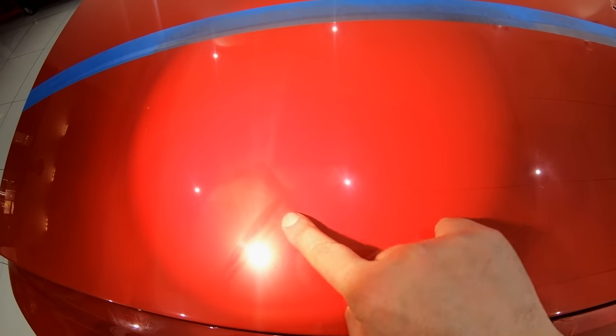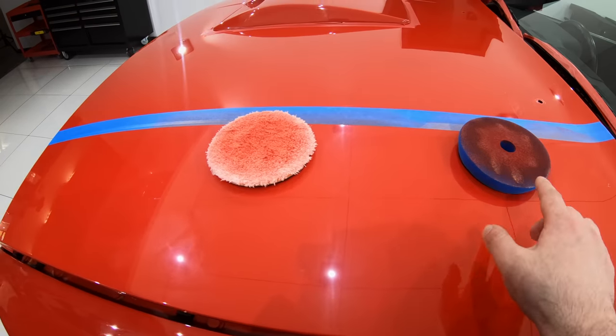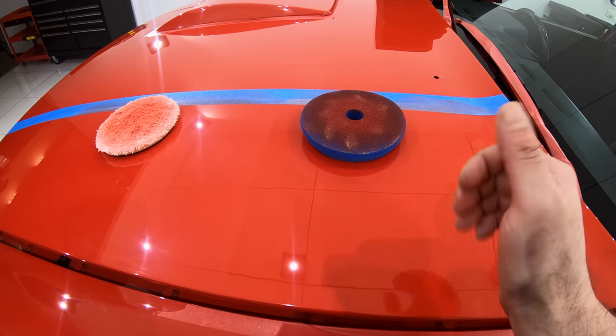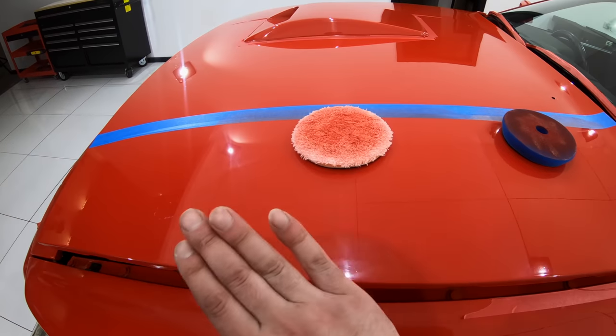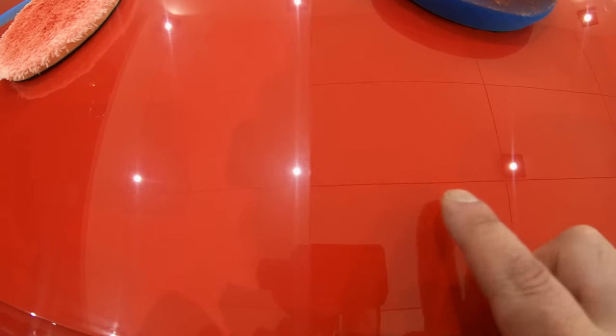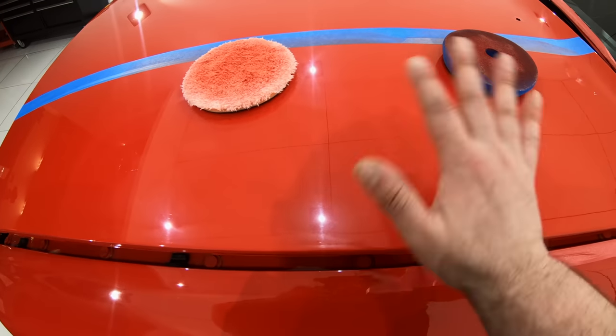A large part of it is the heat, which is just difficult to minimize with microfiber pads, even in a short polishing cycle with Clear Cut and minimal pressure. It also makes wiping off the residue near impossible, as it tends to strongly fuse back onto the paint. So, although microfiber pads can be absolutely amazing on mid to hard paints, they just don't tend to work on soft and sensitive paints all that well, at least in my experience.